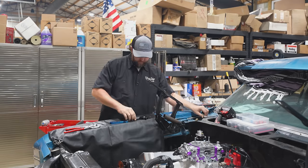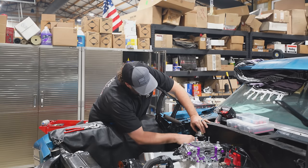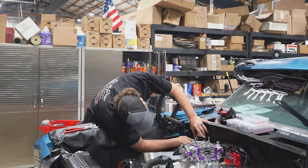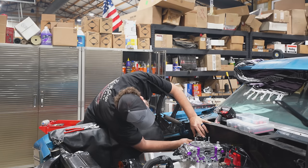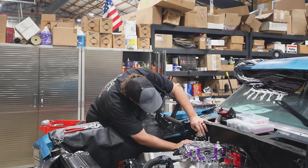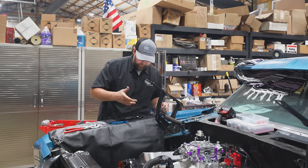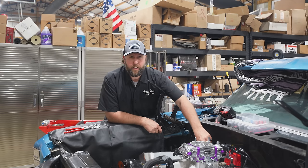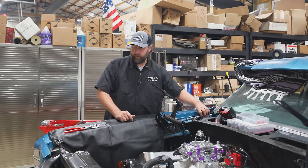Boom. Tighten up my O-ring fittings. See how many gallons these leak. Returns on the bottom there. Okay, hopefully they leak none. You know what I mean? Now we can figure out the line from here to here, and we can run dash 6 on that and start digging through the old goodie box.